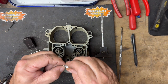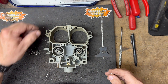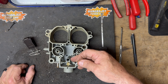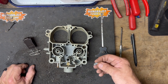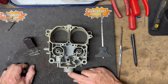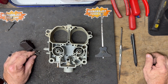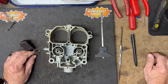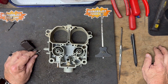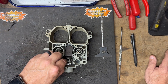If you leave the hanger off and your Quadrajet has backflow problems — having a hard time starting after a few days, which is very common because the float bowls are small and fuel can drain back out — leaving the hanger off means when there's no fuel pressure coming in, the needle sits back down and prevents any backflow of fuel out of the bowl. If you drive on a regular basis, you can leave the hanger off without any problems, and it'll prevent backflow as well.